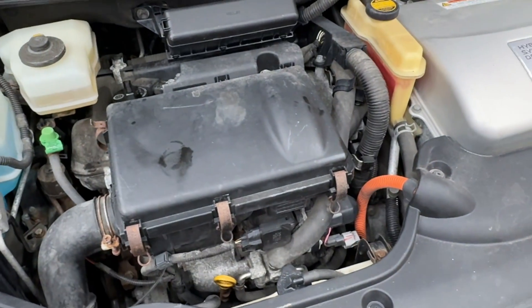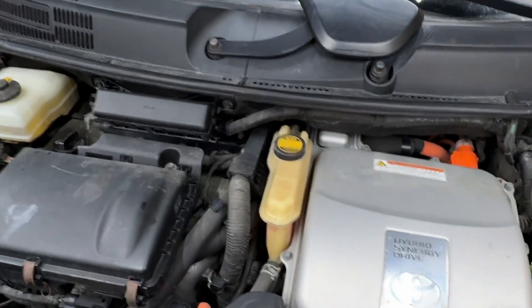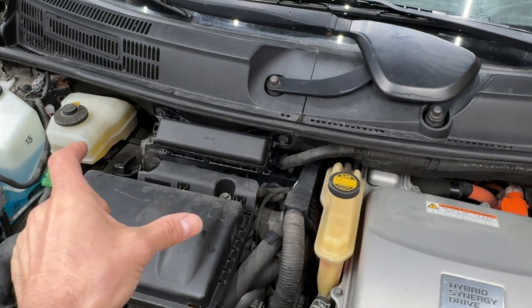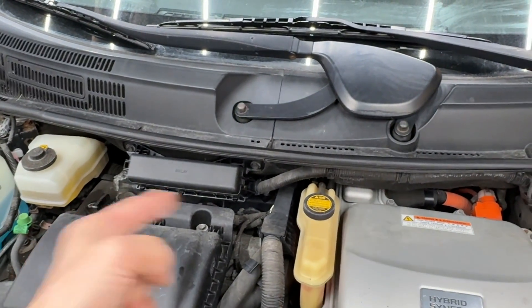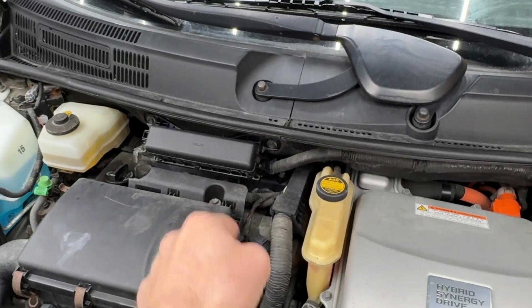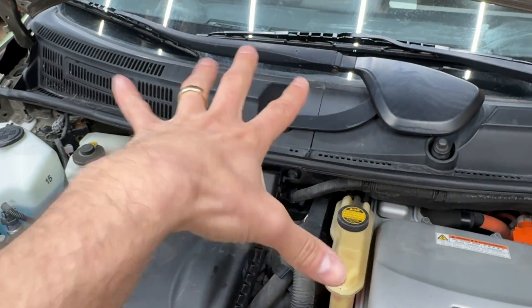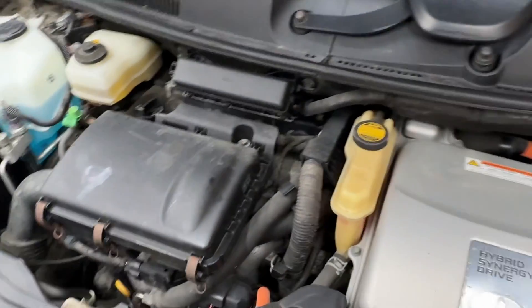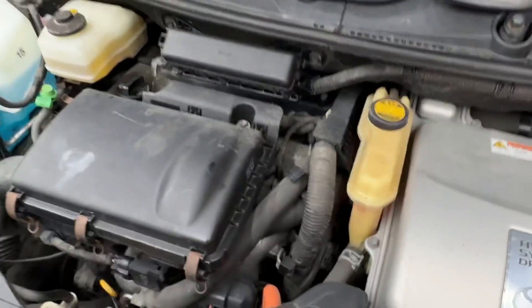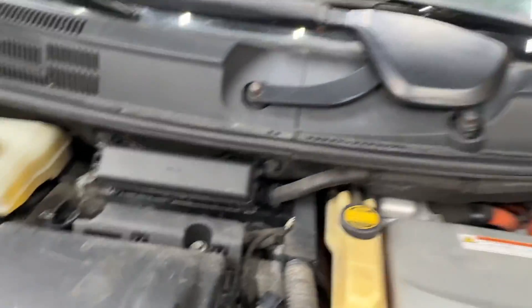Thing number two — and there is a link in the description to a video of me showing you how to do this — fuel injectors. When they're good, they have a fan: they fan out gas. Gasoline in a warm engine should be mixed 14.7 parts air to one part gasoline. If that mixture gets messed up in a warm engine — when it's cold it's more gas, less air — which is why these sometimes misfire on cold start. There's a link in the description to a video about that. As the injectors get weak, they go from a nice healthy fan to a weak, narrow stream. You can get some rebuilt ones on eBay for about a hundred bucks, Toyota Genuine, or maybe you don't mind spending the money buying Denso brand new right off of Rock Auto. They're pretty easy to change — they're literally right there. You've got to take off the air box; again, there's a link in the description.